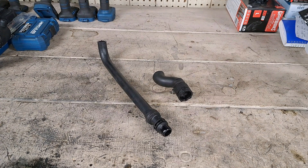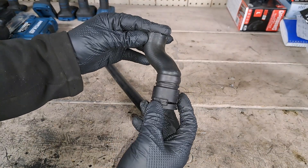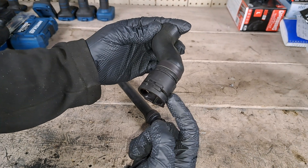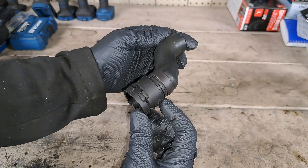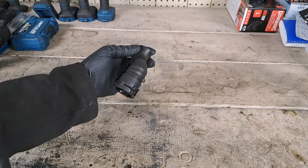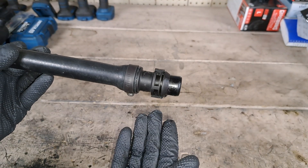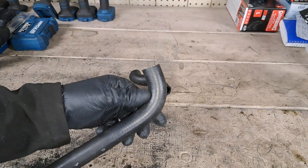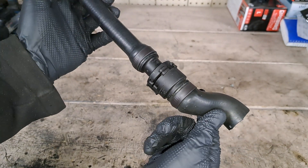Now it's time to discuss the hoses. Starting with this pair — this section goes directly to the water pump and was original to the M5. I cut off the hard-angle section and put in an E46 coupler also found on the E60, which snaps onto a reducer hose. We had to downsize from roughly a one-inch hose down to a 5/8-inch hose using this coupler from an E60 5 Series.